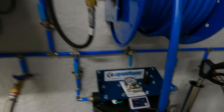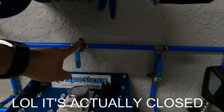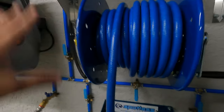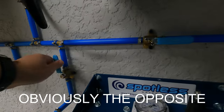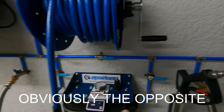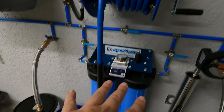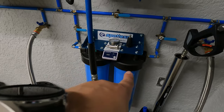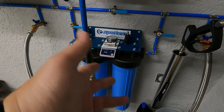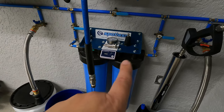Over here for the CR Spotless, we have a bypass system. Right now it's open, feeding straight water from the RO system into everything. But if I want to, I shut this off and turn this side on and this side on, and now the water feeds straight through the CR Spotless. I can have deionized water, which I only use when rinsing off the vehicle. It's a waste to use it while washing the car, especially if you have pretty good water. I have an RO system here so the water is not bad.